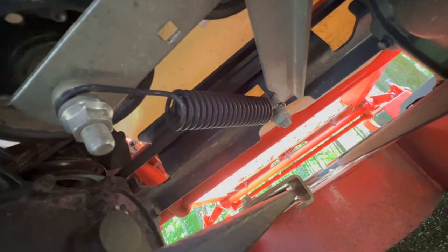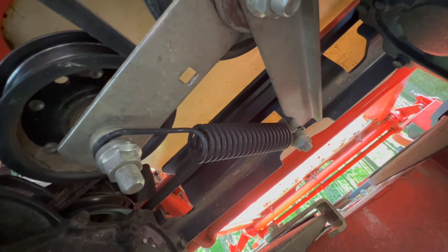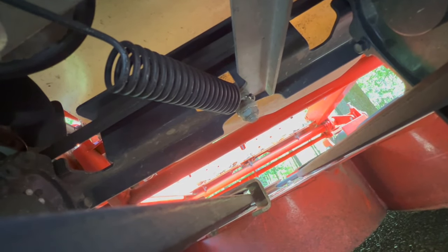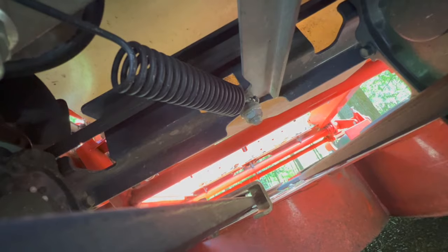This is what the tension spring looks like when it's been put back on. You've got this bolt right here with the groove on it under the pulley — that's the one that's movable. The shorter end of the spring mounts to the front, and it's got the groove up above that bolt and nut on top. You can tell it's made for it — it's got a bar going down through there with a notch cut in it so your coil doesn't bind or rub.